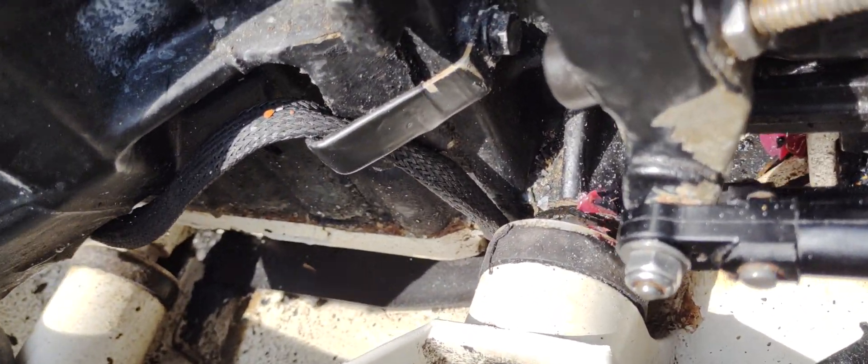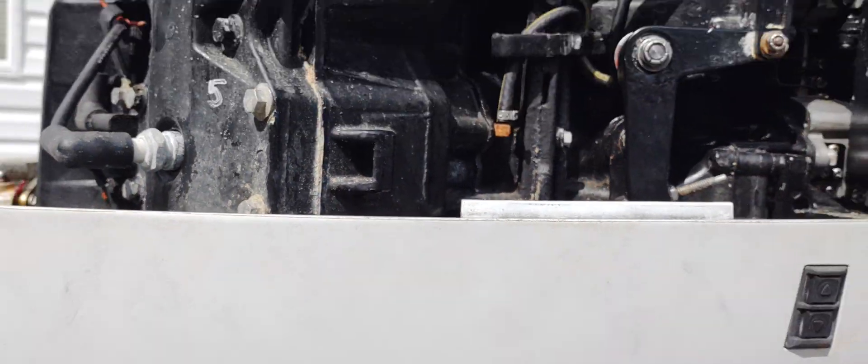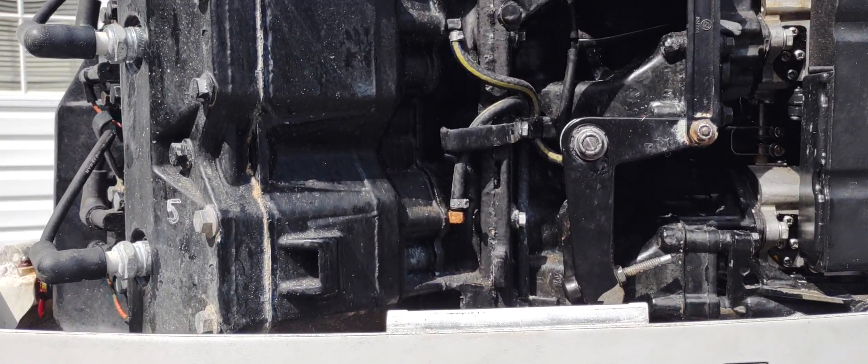You do not want to drill a hole here — please don't — because it kind of kills the whole reason it's set up like this. This is an Ocean Runner; it's supposed to be sealed up on the bottom side any way possible. We don't want to put any holes in here at all. But what generally goes bad is the snorkel — that's what goes bad on them.